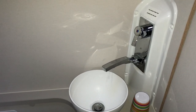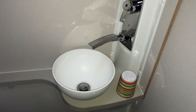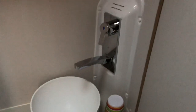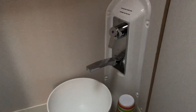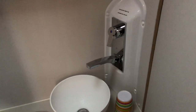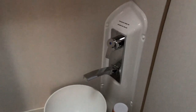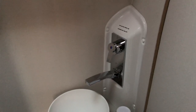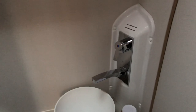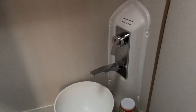You can see even though your tank's drained there's still quite a bit of water coming out. I know a lot of people advise pulling the shower head out and leaving it low down on the floor — to me that seems pointless in this setup because the pipe obviously comes from low down anyway, rises up and then back low down, so you're still going to have a low point. I'm sure that's more for if you've got a shower point mounted up high, but when it's a tap and shower head combined like this, I've drained it as much as I can and the taps are open, so pulling it out on the floor would still not make any difference — it would still have a low point where it connects to the pipework further down.